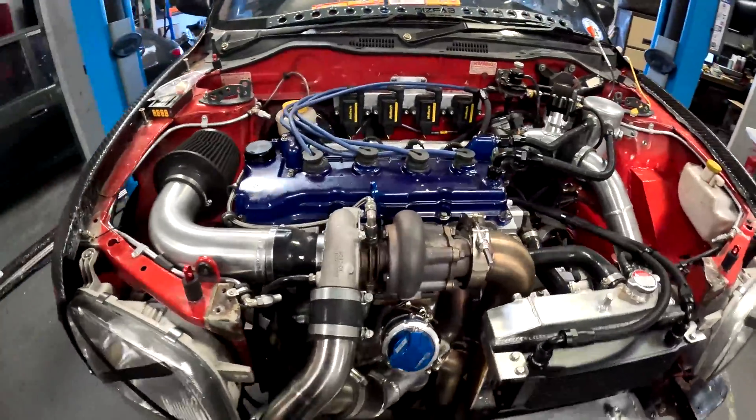Yes, I know — I should have made a plenum, but we're here now. What we're going to be able to do with these EGT sensors is adjust the fueling per cylinder on trim. The Haltech will target the same EGT temperature across all four cylinders and do that by adding and removing fuel to suit.